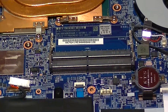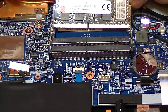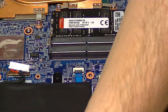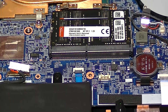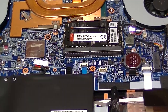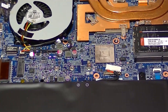The first thing we're going to install is the RAM chips into the RAM slots, and that is going to be the simplest process. This DDR4 memory has a nearly equal number of pins on each side of the slot, so make sure you insert it the right way. Push it in until you no longer see the gold pins, then press them down and they lock into place. On a scale of 1 to 10, this whole build process is no harder than a 5, and we'd rate the RAM installation about a 1.